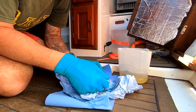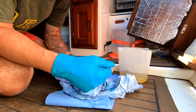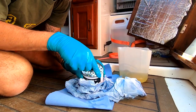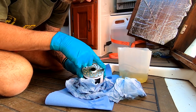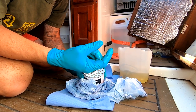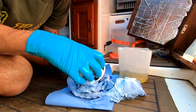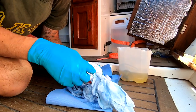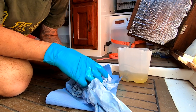I've had issues before with primary fuel filters — all it takes is the slightest little dink or dent, something that's not going to sit nicely in that rubber seal, and it will leak. There's no science to it; just going around feeling for any low spots, dips, or misshapen bits. All seems fine in there. Now I'm going around the base here, having a good look for any little dents or imperfections that could possibly make it not sit nicely in the seal. I'm happy with that.